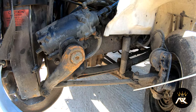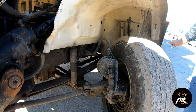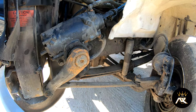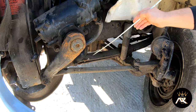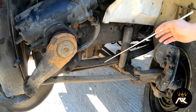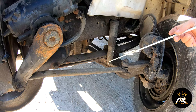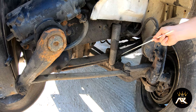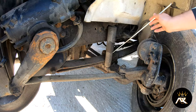I'll talk about my suspension. I have front and rear spring hangers. They're all properly mounted and secured, not bent, broke, or cracked. It's not missing any hardware. My leaf springs — we have multiple leaf springs, so we've got to make sure that they're not shifted or scissored, and none are obviously missing. We have U-bolts. They are present and tight, not bent, broke, or cracked, and the bushings are intact.